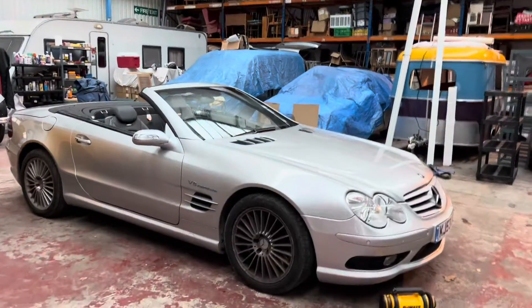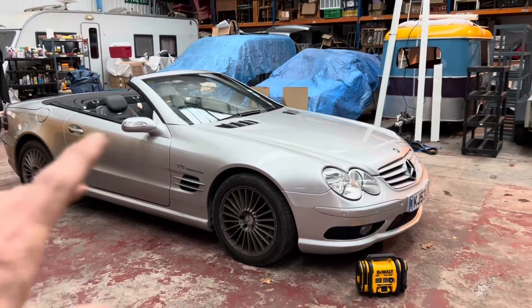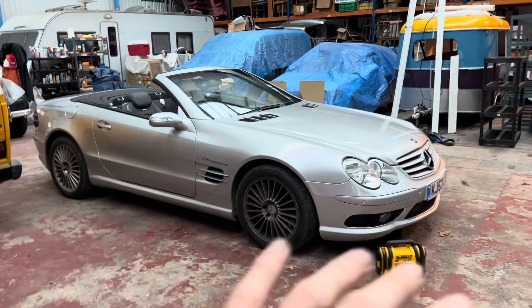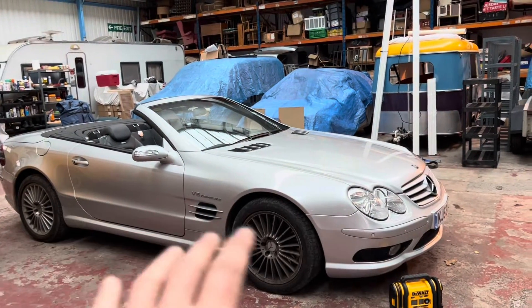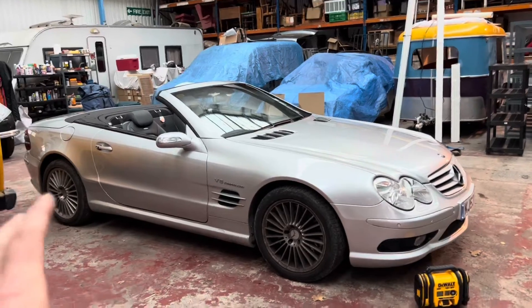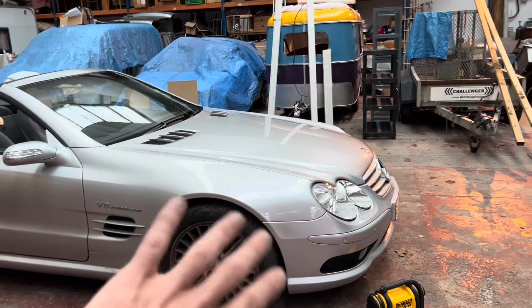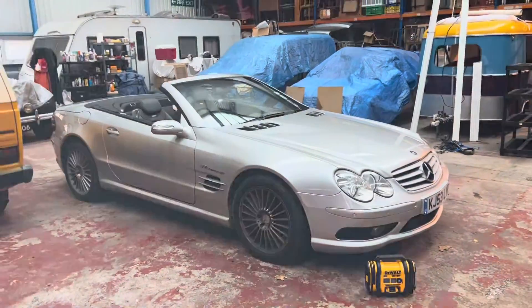To start this process it's important to make sure your car is on level ground — we've pulled this car back into the unit and it's on pretty much level ground. It's worth checking that the tyre pressures are all as they should be and that you haven't got one tyre flatter than the other. Last but not least, make sure the wheels are pointing forwards, because as you move the steering wheel that will change the height settings on the struts.